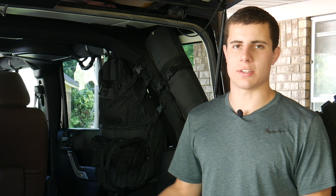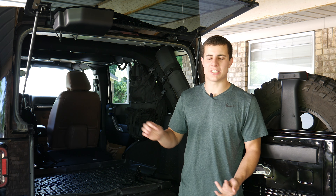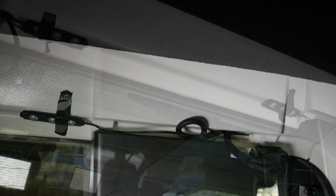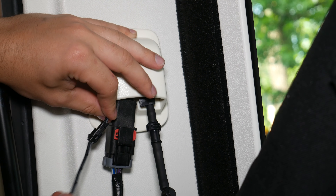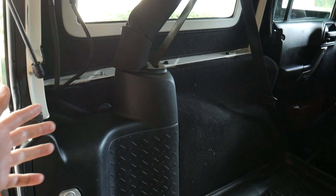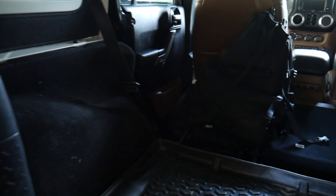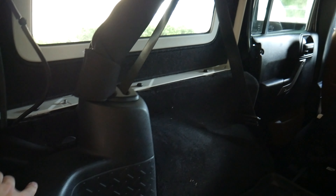For the next project, we're going to be adding lights to the cargo area. If you've ever tried to load something in your Jeep at night or do any kind of work back there, you'll quickly realize that the stock dome light is just super weak. We're going to add two downward-facing lights on the top of the hard top, run cables through the hard top, put a disconnect where the other two factory connectors are so you can still remove the hard top, and then power them up. If your Jeep has the factory 12-volt port back there, you'd just tap into that power, put a small push-button switch there, and you're good to go. I don't have that port, so I'm going to run power from my switch panel down along the side of the Jeep to the lights.